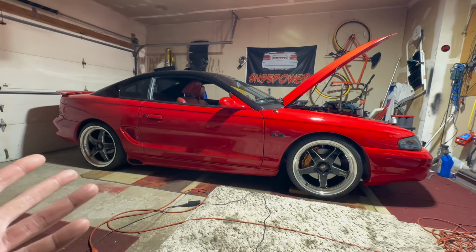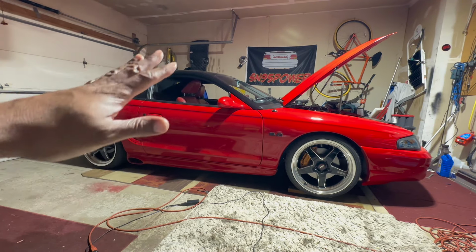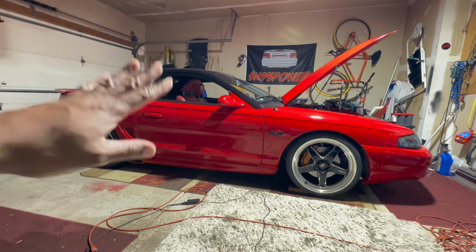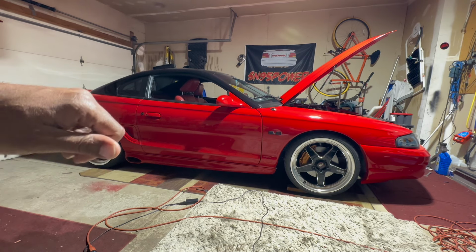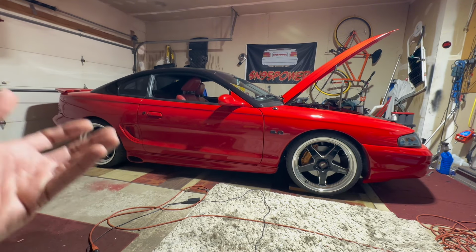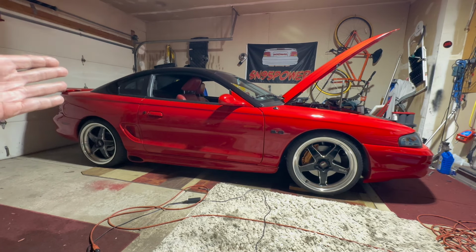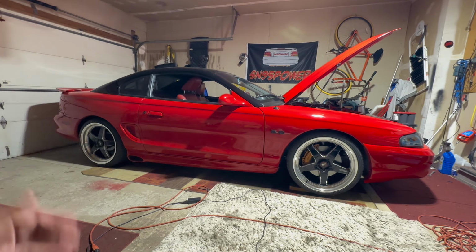And I just wanna be clear on these cars. 200 degrees is not an issue operating temperature with these cars. Now, why I wanna keep my car around 190 degrees is because this being turbo, whenever it starts spooling, it's gonna generate more heat. And the bigger threshold I have away from like 220, 230, the safer I'll be pushing this car or doing some pulls.